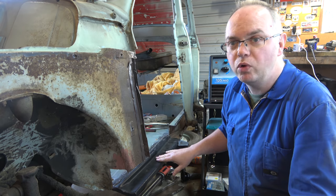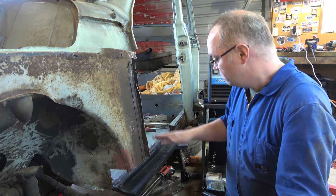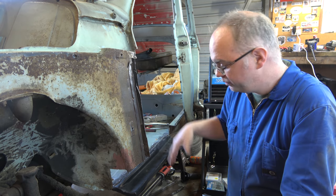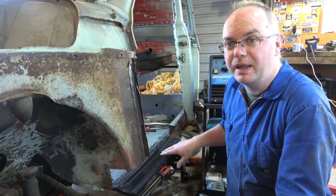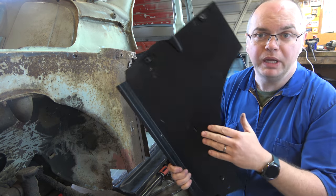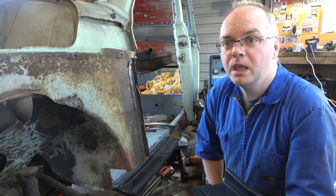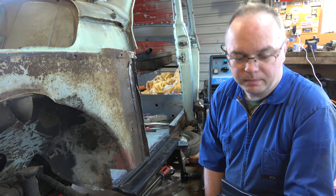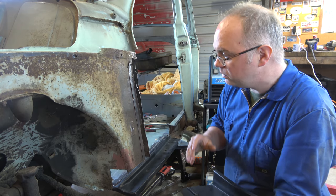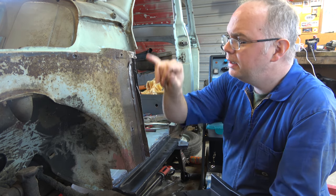It wasn't an issue on the floor panel there because we're going to take it off anyway, so I left that on there. Yeah, it's not hidden anyway, so we can clean up that panel, prime it, paint it. But this one, the back of here, we can't get to again, so we'll make sure we're all zinc primed, top coated, whatever surface prep we're going to do on this. We haven't quite figured that out, but yeah, I'll get on to that.